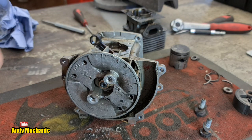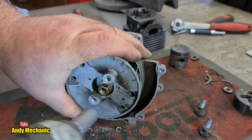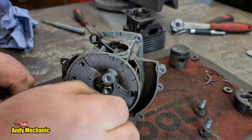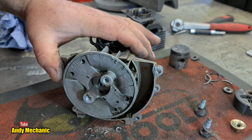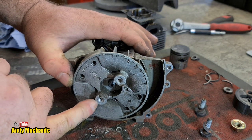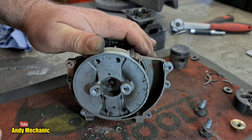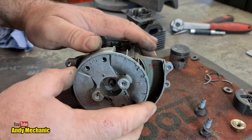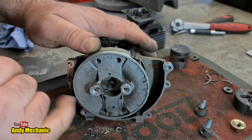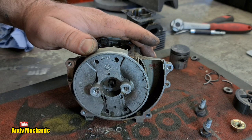Is that a 14? No, we need a smaller socket. A 12 — yes, excellent. Here we go — it wasn't very tight. One nut. The question is: is that just going to come off? And the answer is no — I imagine there will be a puller in the Ryobi special tools kit that bolts to here and has the puller centre that goes against the crankshaft to pull that flywheel off. I don't have one. I do have a normal claw puller, but with this being an aluminium flywheel that's normally a very bad idea. Given the fact that this thing is now scrap and definitely not worth fixing, I can use a normal puller just to hook onto there and get the flywheel off.